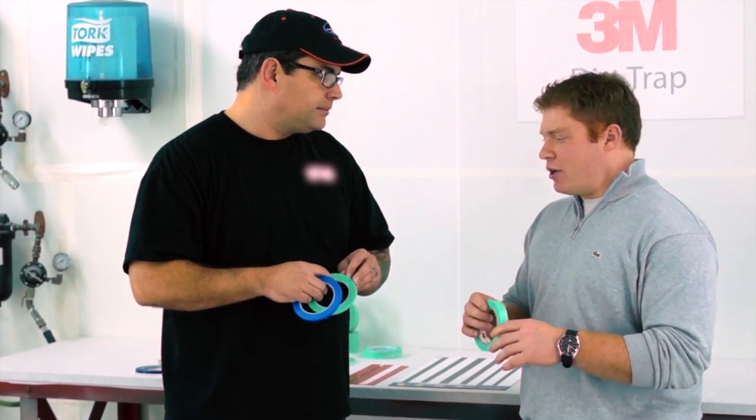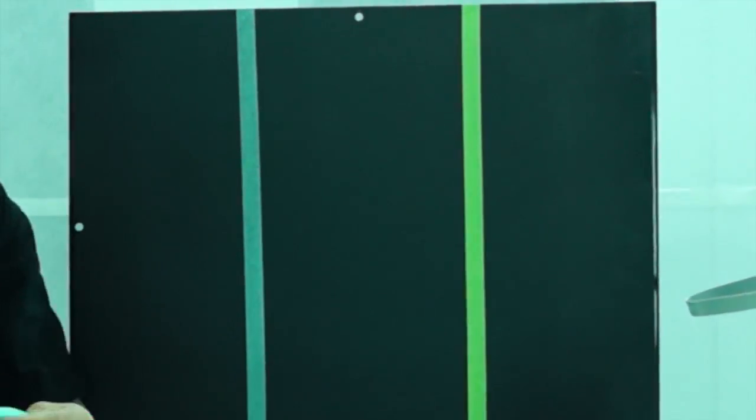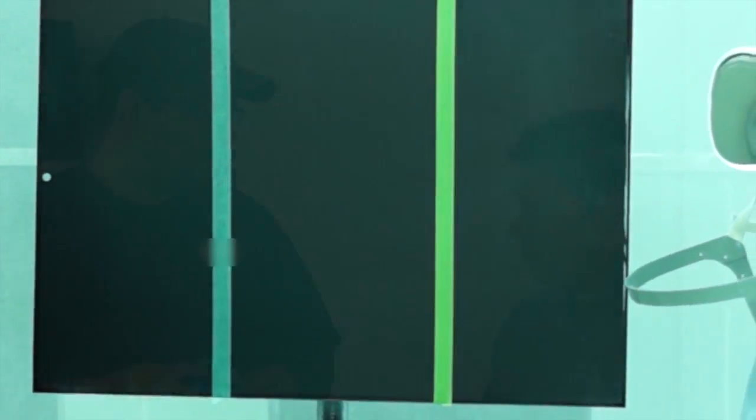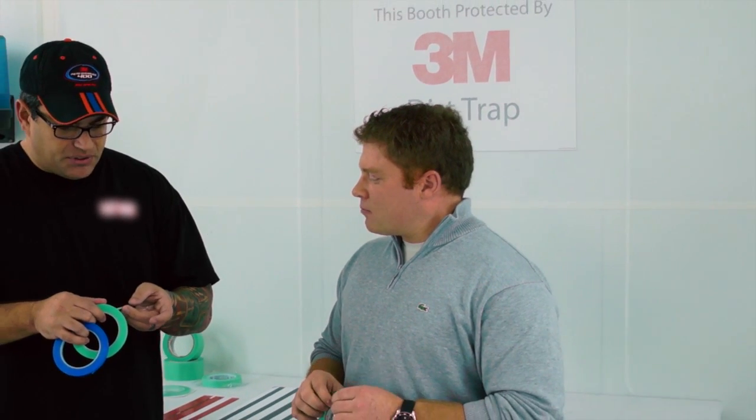This tape is a lot thinner, so it allows for a much lower profile paint line than what you would get with any of the crepe tapes, including the 3M crepe tapes. With waterborne, it's thinner, so it has the ability to flow more than your solvent base — it can get underneath and start to bleed a little bit easier. So with this tape having an acrylic adhesive on the tape itself and a very flat type backing, it allows for a very low profile. It's also excellent with waterborne because it locks out the water from getting underneath, protecting what you want to protect. You can actually feel it in the material on your hands and fingers.